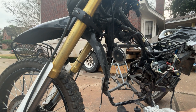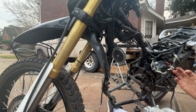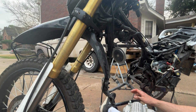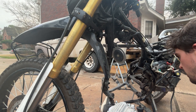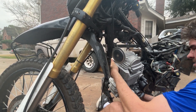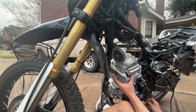Let's get started. Coming to the bike, this motor is pretty heavy — probably around between 60 and 80 pounds. So if you're not strong enough, try to get somebody else to help you with this. Put it back in the same way it came out. My hands are on the exhaust stud and the gear shifter, and we're going to have to put it up and in here. I'm trying to line it up with these holes in the motor — not really focusing on the front, but more the back holes. Try not to run it against the ground if you can.